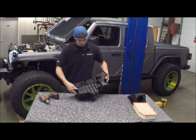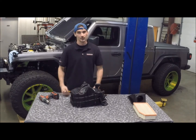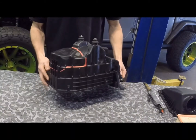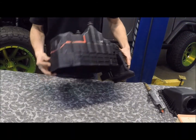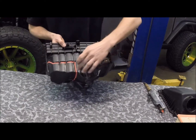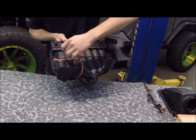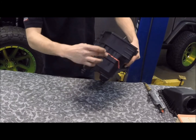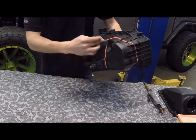What we're going to do is mark the bottom we're going to cut. So we've got the air box all marked up here. As you can see, you're just going to kind of follow these ribs in this step here. When you get to this point, you're going to come up about halfway in between here and here, and then you drop back down and connect it.